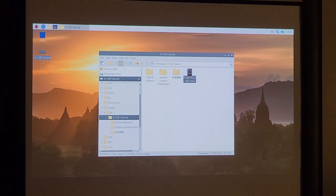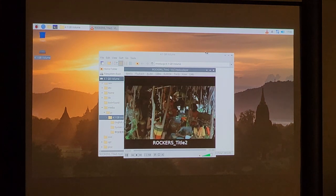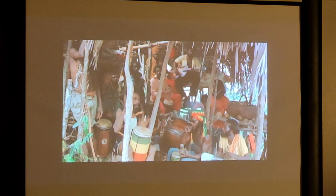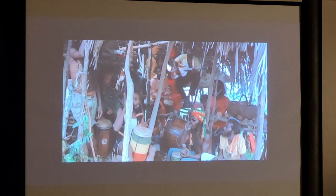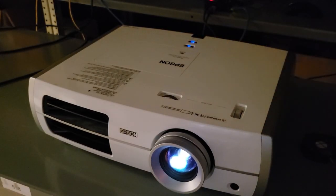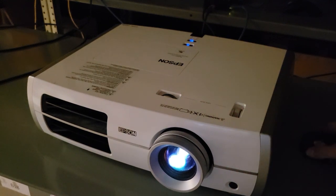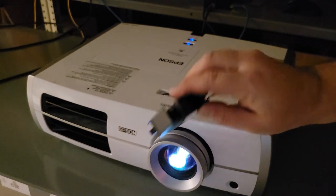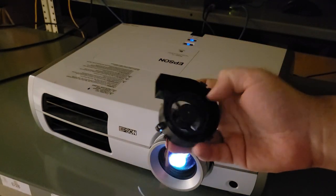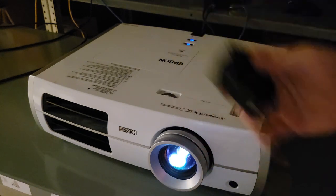All right, so I'm just going to run this video on repeat. It should go fine from here. Yeah, it's a great picture. You know, Epson, I'm not a huge fan of Epson, but I will say their pictures aren't bad. So I'm going to let this run for a couple hours, and as long as it runs for about 3-4 hours, I'm going to call it good. When I got it, I suspected it was the fan, and sure enough, it ended up being that lamp blower fan. Just doesn't spin. Wasn't locked up or anything, just had a bad motor controller, I guess.